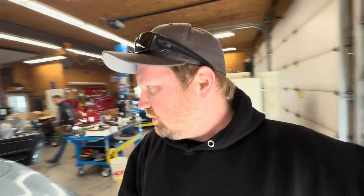What I think happened was they picked these up with forklifts and moved them around at the salvage yard, and I think the forklift just broke the exhaust. I mean, it had a bunch of tiny little hairline cracks in it. I think that was throwing off the O2 sensor with the HP Tuners, which is why I was struggling so bad with it. It would want to run, and then I'd make a change, and then it wouldn't run, and then it'd tell me it's lean, and I was just chasing it. I was struggling. Anyways, I'll show you the clip that my dad sent me while we were on vacation.